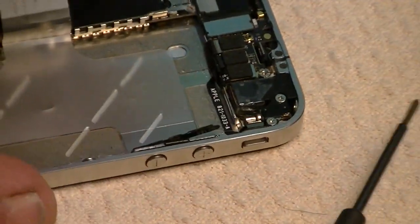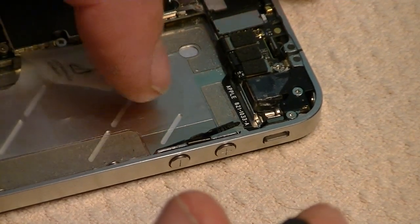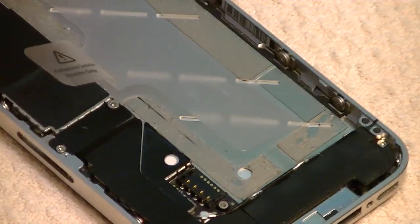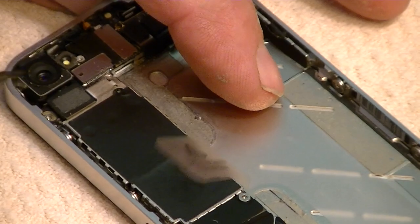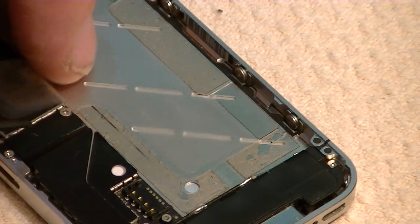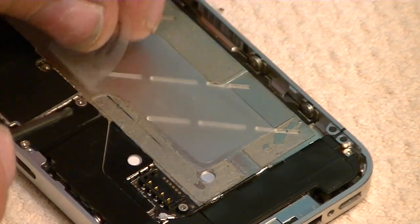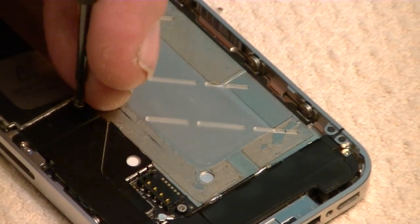Okay, so we got the shield off. Now, there are two screws that hold the motherboard connector here on the side below the camera. This is the camera up here. And then on the side here next to the camera, next to that pull tab that we pulled up, notice that did come up by itself, not with the battery. Okay, it's separate. So we remove those two screws